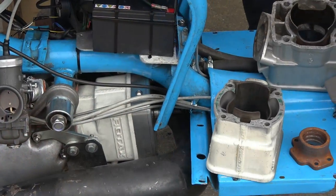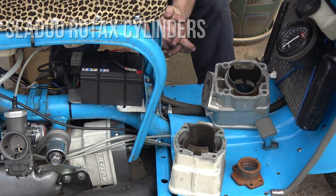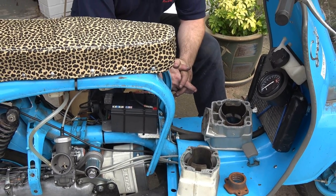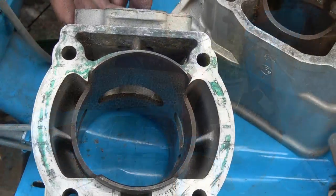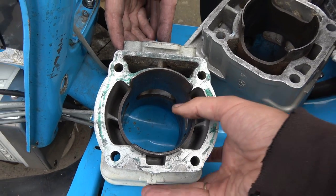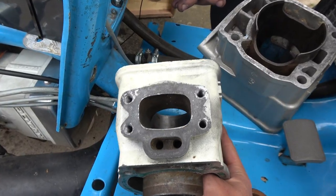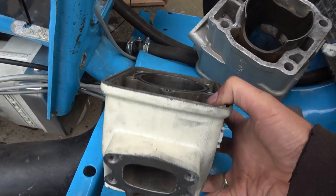The cylinder is a 1995–1998 Sea-Doo 580 or 587 jet ski engine. It's also common to other types of Rotax on Bombardier cylinders and snowmobile engines. It's a die-cast engine with an iron liner. Its port timings are 125 degrees transfer and 182 exhaust, or thereabouts.